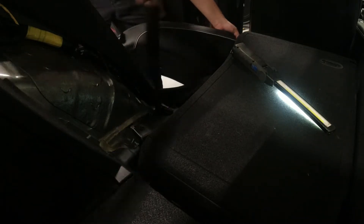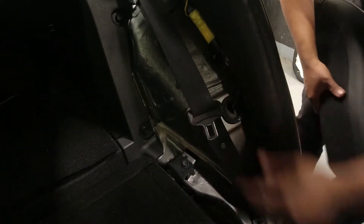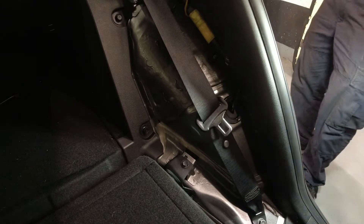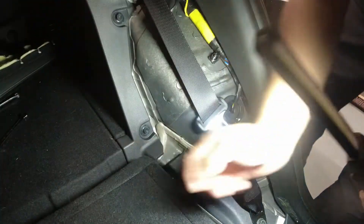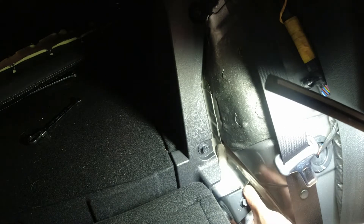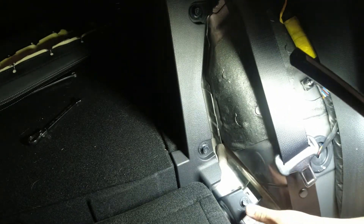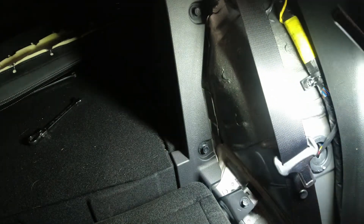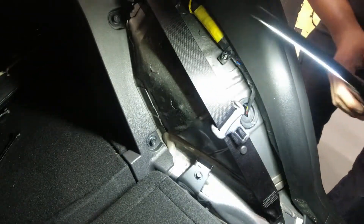Put it aside. The one that we removed is not for the back seat — it's for this side cover or side cushion. So we remove the bolt at the bottom and then we lift this up so we can slide it out. Now this bracket here — we can remove the whole bracket. It should be 10mm, and the same on the other side too.